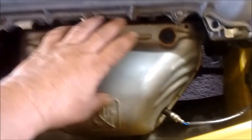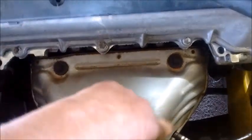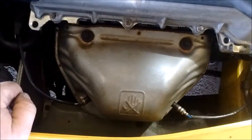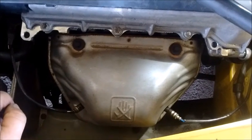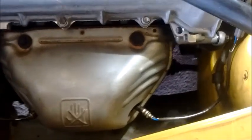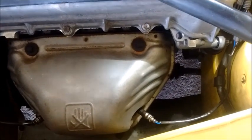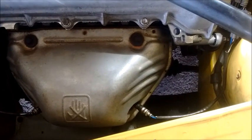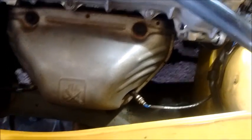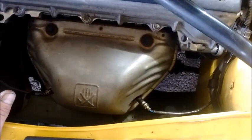The car has an exhaust header with two catalytic converters on the header there under this heat shield. Can't really see them. But the way that you check them for damage is you need to remove the O2 sensor and just look inside with a bright light. You can tell pretty easily what's going on with your pre-cats by doing this. So that's what we're going to do.